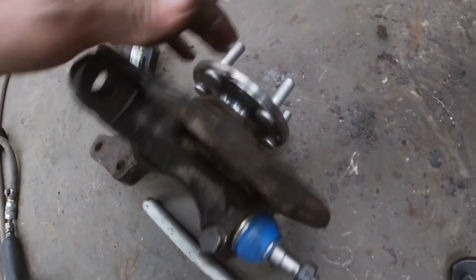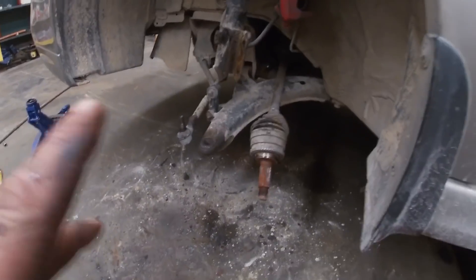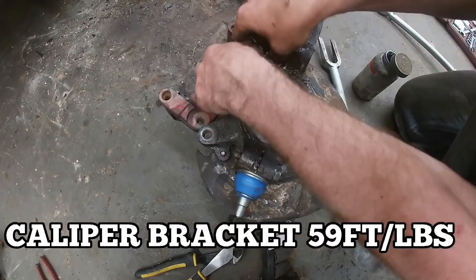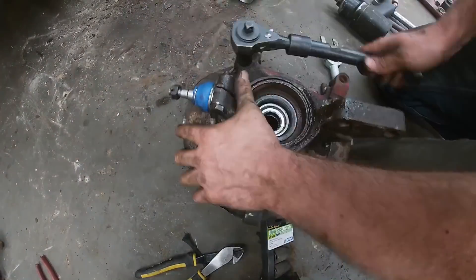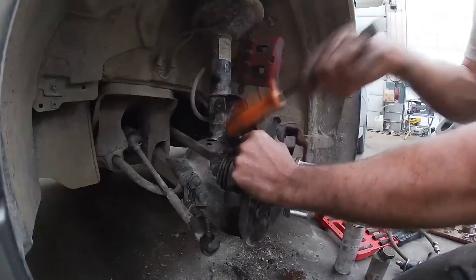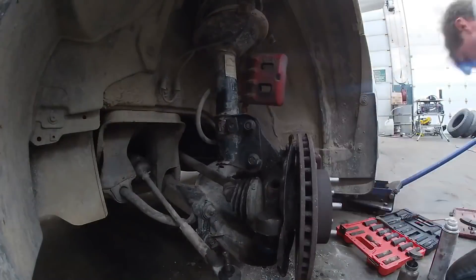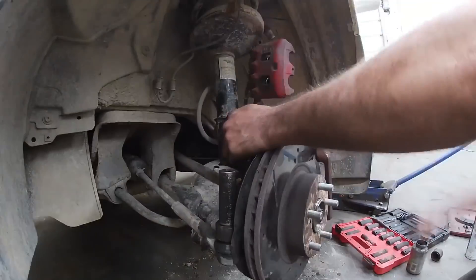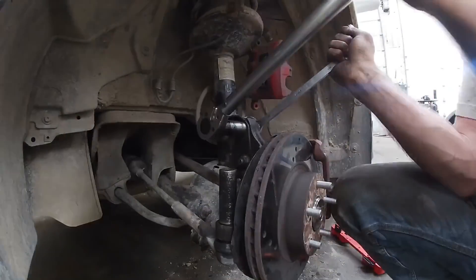That's what I ended up with — new hub, new bearing, and I went ahead and put a new ball joint on as well. I'll put you on time lapse and we'll see if we can get this thing all put back together. For a guy DIY-ing and not really knowing what he's doing, it took me about five hours. I'll throw a few torque specs up that I found online. Little hint — don't put the brake bracket on before you put this all back together, because you've got to put the brake rotor on first. We're going to get this all put back together, head to the house, hop on the John Deere 755 compact tractor, get out on the road, and then get the drone in the air for two southbound barges.